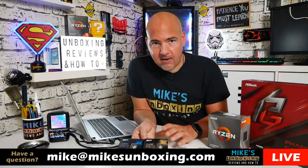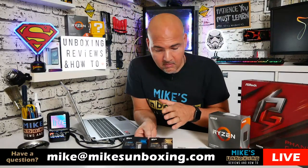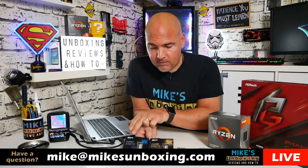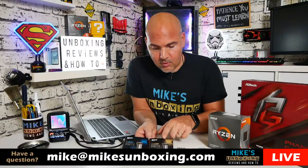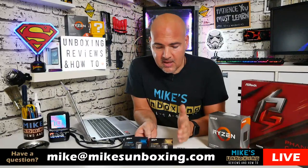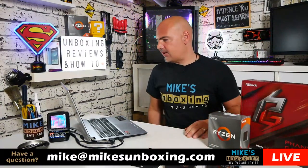But also to compare and to see what is more suitable, depending on your budget, we've also got two of their new NVMe drives. All of them come with, sorry, the SSDs come with a 3-year warranty, the NVMe's come with a 5-year warranty. We've got 2 1-terabyte drives. One of them is PCI Express Gen 3x4. And then we've also got their really brand new Silicon Power Gen 4x4 drive. So we're gonna be doing some direct comparisons and seeing what the transfer rates are like, and also if it actually makes sense buying depending on your use case scenarios. So yes, we will be looking into all those things on the PCI Express 4x4.